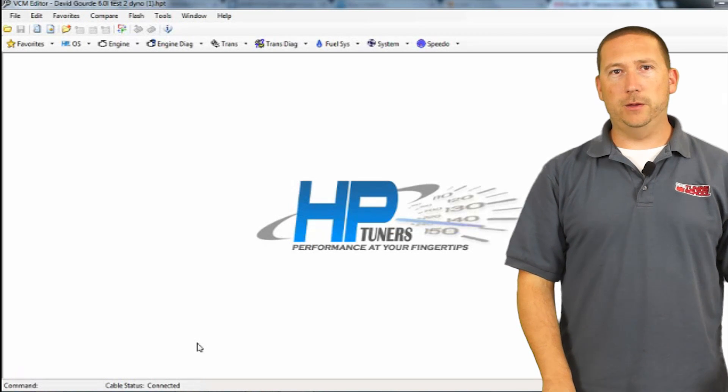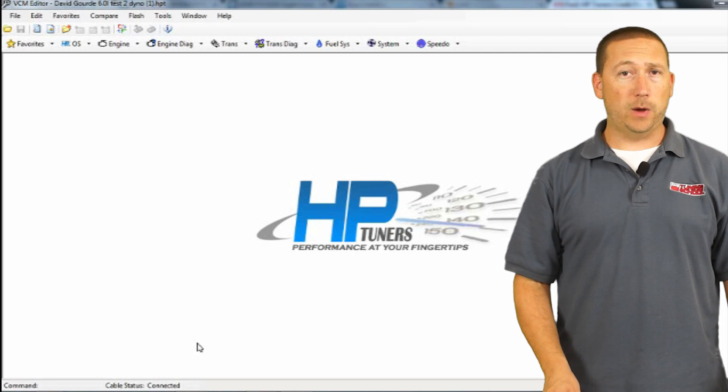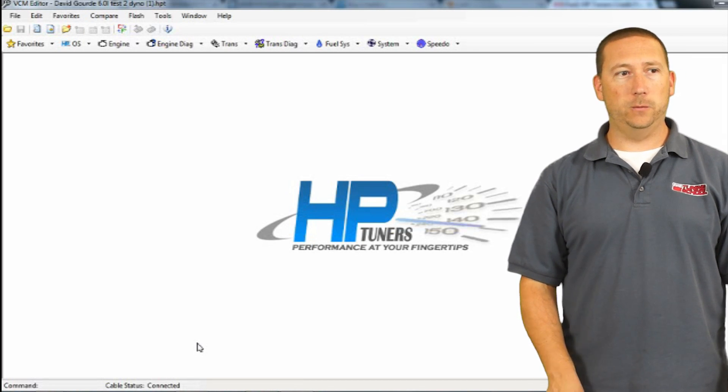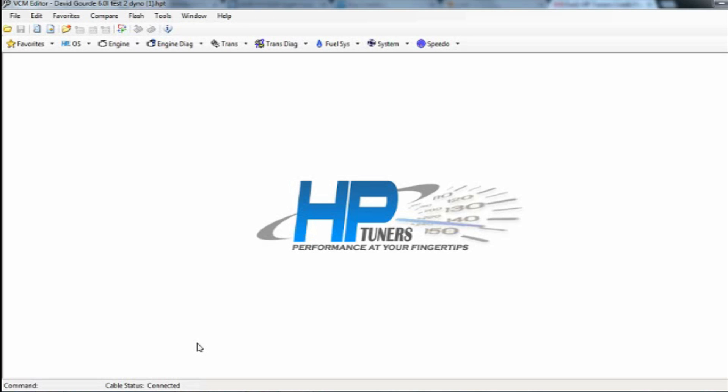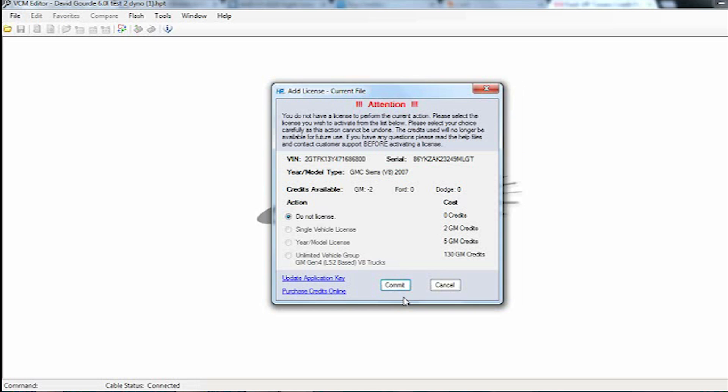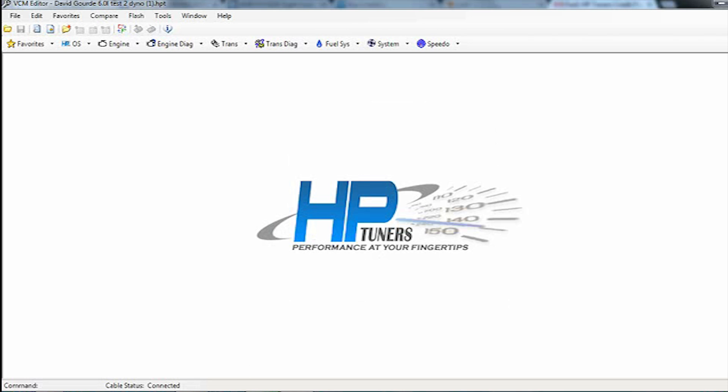Okay, credit questions for the enthusiast. Usually the calls we get from enthusiasts are: how do I tune my car over and over again? It's very simple — buy the credits needed, which is usually two, and license them for your vehicle when you connect. Download your tune file from your car. Once you've downloaded the tune file, it's going to say hey, you've never licensed this before — what do you want to do with this car? Click the Show License Options button. Since you're connected with your hardware and your HP Tuners, it's going to say you have X amount of credits available — how do you want to use them? As an enthusiast you're usually going to pick Single Vehicle License, which uses two credits to license one vehicle. Click Single Vehicle License and then click Commit.